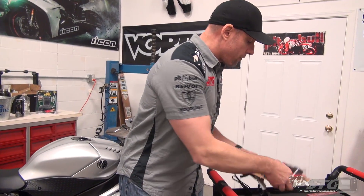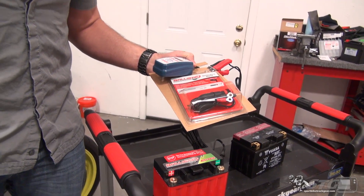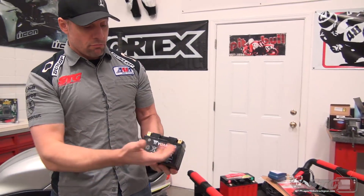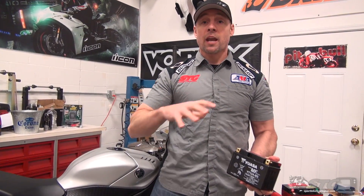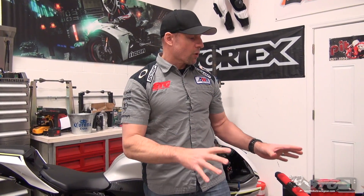With Ballistic, they offer this EVO power system, which gives you the opportunity to get that battery up to 100% before you ever put it in the bike. For a conventional battery on a street bike or race bike where you put the acid in, it has to sit for two hours and then be charged to 100%. If you start off with any one of these batteries and just throw it in the bike, that is going to be the baseline — the best state of charge it'll ever achieve. They kind of have memory, so it's important that before you ever use it, regardless of style, you charge it to 100%.